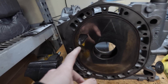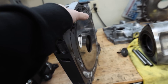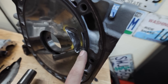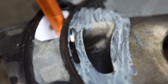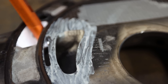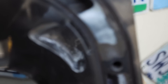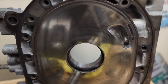I'm pretty happy with the porting on the center iron — both came out super nice, super clean, and very smooth. The porting on the front iron also came out perfect — absolutely perfect, no blowouts. You can see how much more that has opened up. We've got our half bridge right there and the bridge on there too. I went through and Scotch-Brite'd and cleaned the rotor. You can clearly see I totally blew through on the rear iron — that right there is my $900 mistake. Live and learn. What I did differently on the front iron was chamfer the tip instead of following the port all the way up, so it's got a small chamfer that runs into that bridge, and that allowed me to not blow through into the cooling jacket.